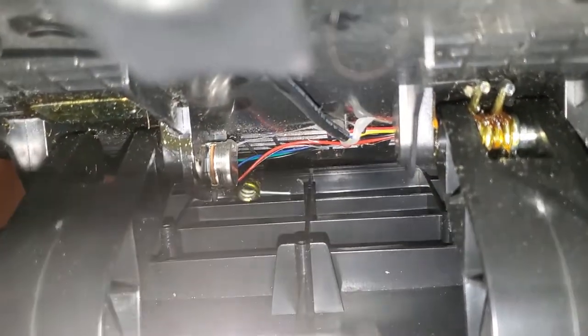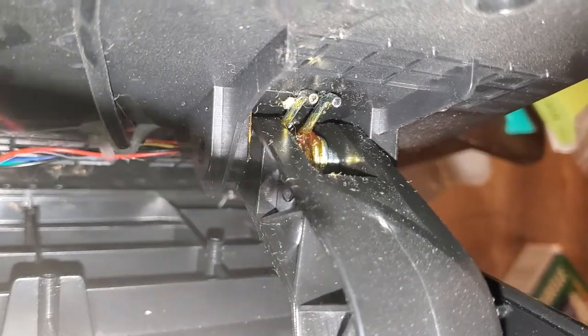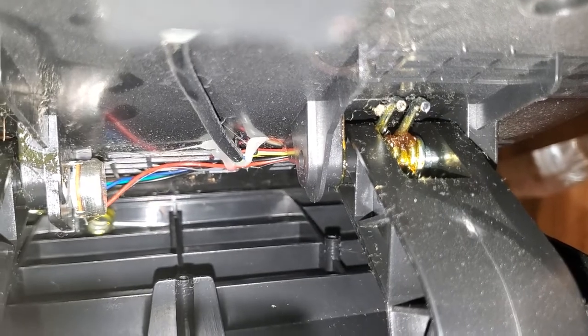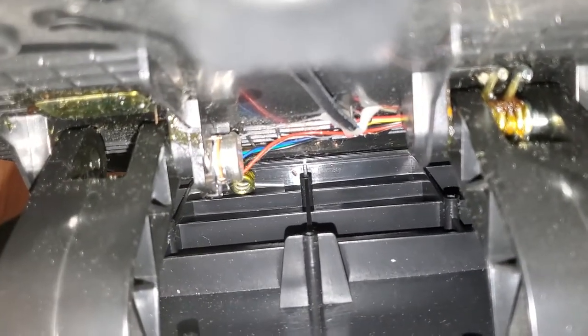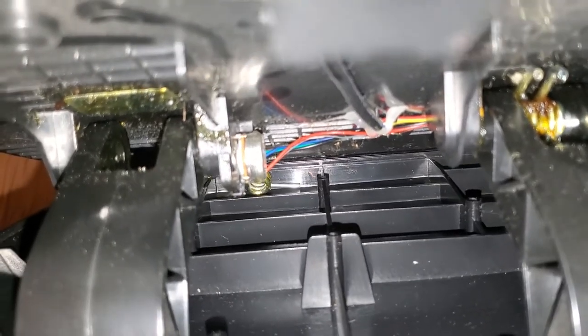Now that I've pulled out this pin, I'm going to start working on those springs. They're quite difficult to bend — you'd need a really good pair of pliers. But I'm going to try to reassemble it with only one spring instead of two. I think that would mellow out the brake pedal a whole lot. Let me try that right now.